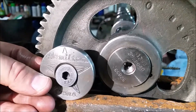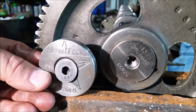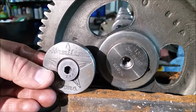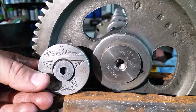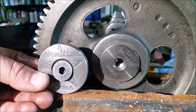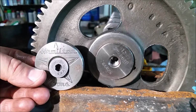That's a good point. We used a micrometer, and we had it about 15 millimeters when we stopped. So we should have probably gone to 16, 16.5 millimeters. Yeah, probably at least 16. So we undercut it just a little bit. My tip for this is 2 people. If you don't have a drill press that's big enough where you can square this thing up, it was really handy to have somebody eyeballing my up and down level while I was paying attention to being in line with the camshaft. Yep, that's pretty good.